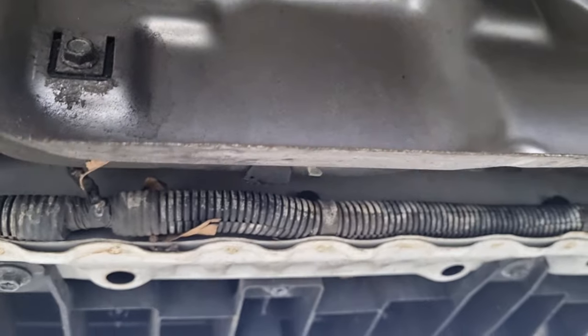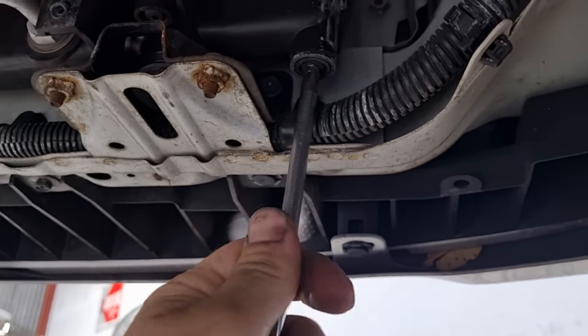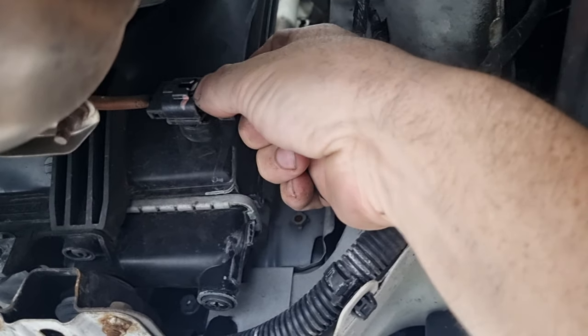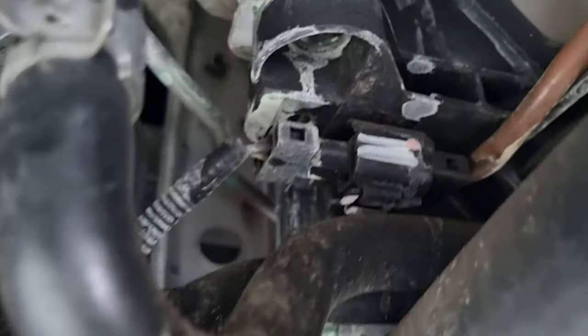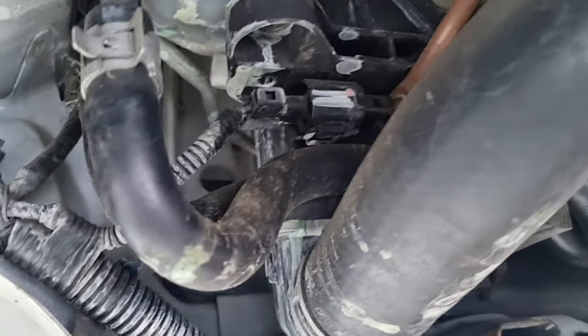Once you've taken those out, it will just come off and give us access to the radiator underneath. We've got a drain for the radiator here — it's a Phillips head, one screw. Make sure you're draining it into a tray. We end up putting it through the plate separator. Get that draining out, and then while we're under here we can get the fan. To do this you've got to push the clip up and then pull that out. There's another one on the other side at the bottom — it might be a little bit hard with one hand.